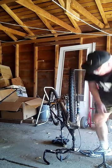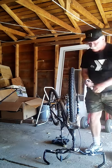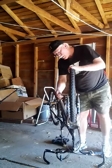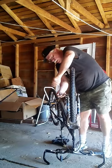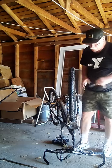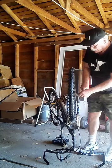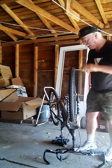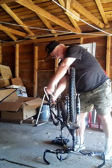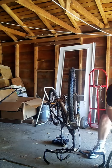That's the front brake. You can see it's not rubbing on any of the brake shoes. Tighten up a little bit on this side and a little bit on that side, making sure it's even and centered so it doesn't hit one of the brake shoes. Give it a test — we're good. Now I'm going to crank up the axle nuts all the way. That one's tight, and now this one. Cool, so that's all ready to go.